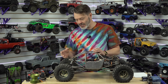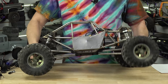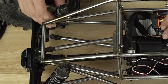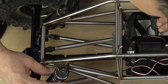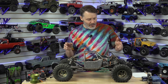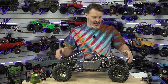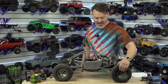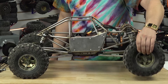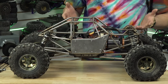If it feels too easy to actuate, that's when spring rate is going to come into play. I'm not sure what these stock springs are — they've got a little red paint at the top indicating a certain spring rate. If you want it stiffer and less articulation, you would increase your spring rate. If it's not doing enough, you would decrease it. On this one it locks out and lifts up, so I don't feel like I need to change the spring rate.